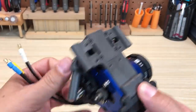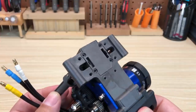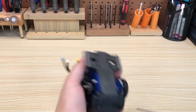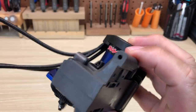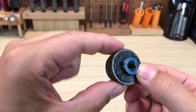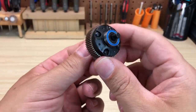You've also got a dropout trapdoor here for the differential. And there is a brand new differential in this transmission — it's a sealed bevel gear setup. The trapdoor screws come out, you push on the outputs, and that pushes the differential right out. It's a steel gear on the composite differential housing, with four screws clamping it shut.